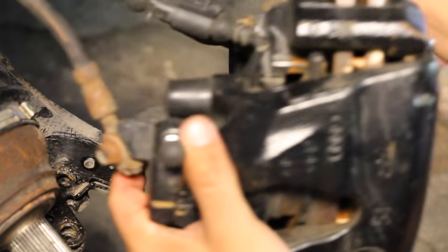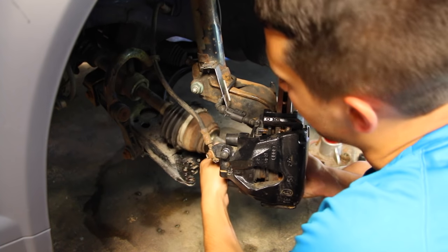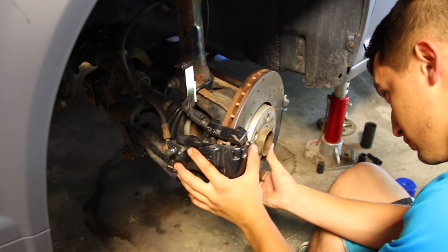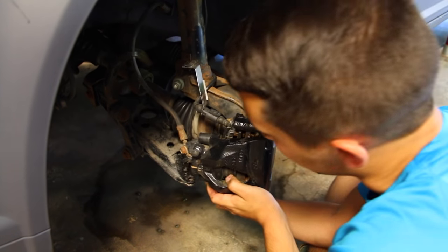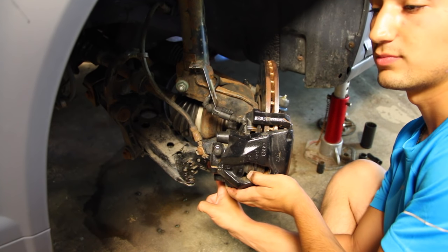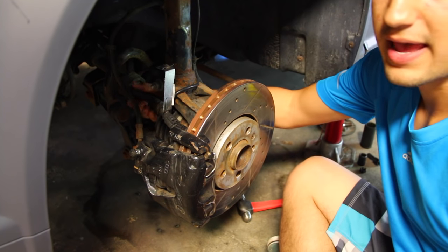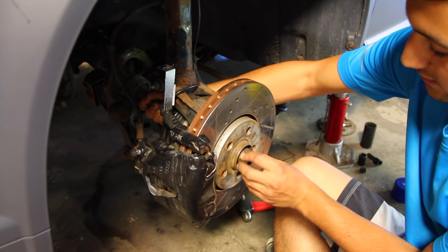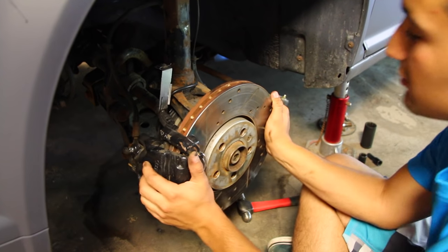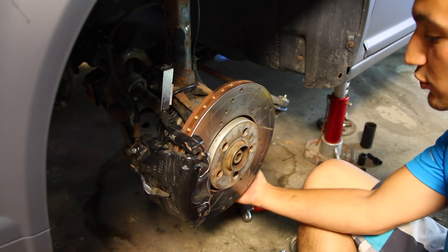We're going to turn this tire assembly back into place and feed the axle through the backside. If you swing it out you'll be able to guide the axle back into place through the hub. While guiding that through, you want to line up the bottom side of the ball joint so it lines up with the three holes on the bottom of the control arm. Pull the axle through, push it forward, and grab the 30 millimeter nut and just thread it on so the axle isn't going to go anywhere — that's going to pull the whole hub and everything back into place so we can secure those three bolts on the bottom.